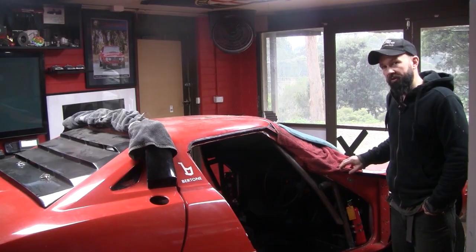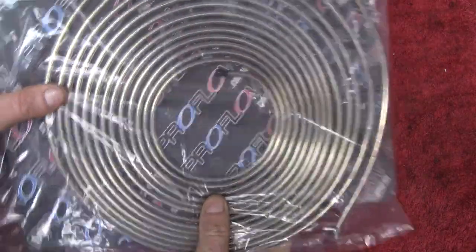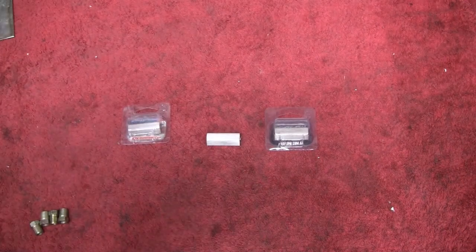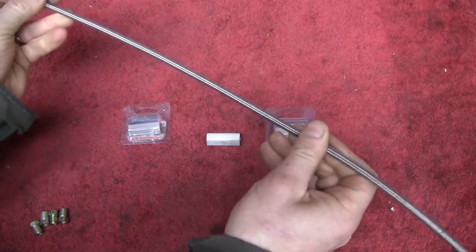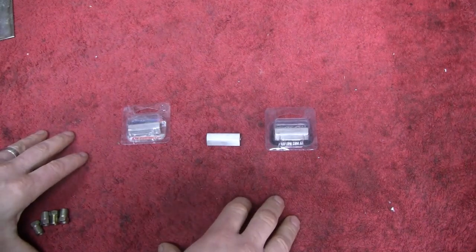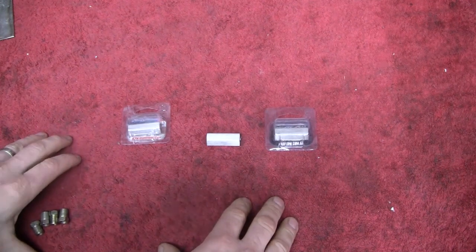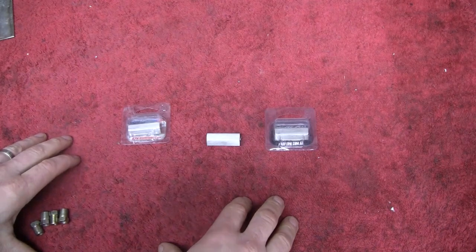I think it's time to have a look at the brake lines. We'll be going with this more conventional hard line for the majority of the brake system to hopefully improve pedal feel, until we get out to the wheels where we'll be using some more of this flexible over-braided stuff. The first thing we'll do is create the junction between the two — the flexible and the hard line — and also a bulkhead fitting to get the hard line from the pedal box out of the cabin.